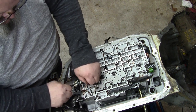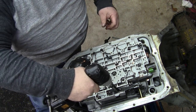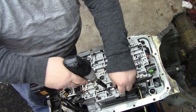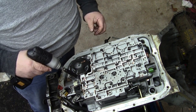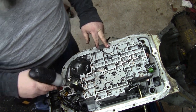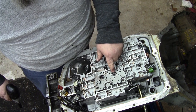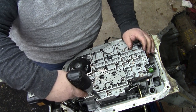This thing has had more transmission fluid on it than I can think of — it was my first cordless tool I bought and I did a lot of transmissions with it. Take your manual link out. The later model transmissions you only take certain valve body bolts out because there actually are two halves. These older ones are all one piece, except for these little 8mm headed jobs — that may be an exception, you may have to take these out too. It's been a long time since I've done one of these.